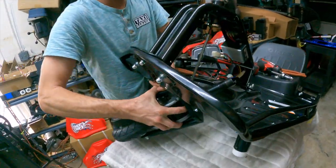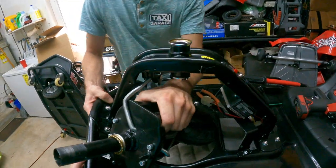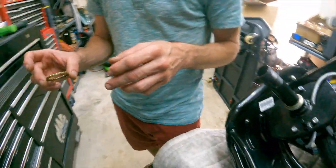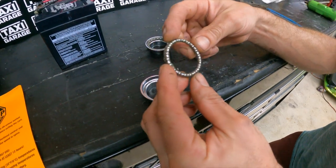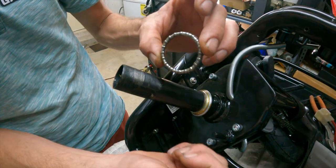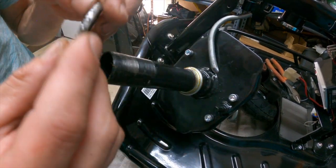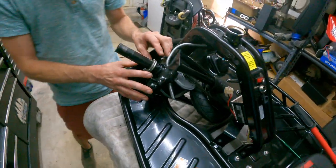Pull this piece out to the side, then set the cart back down so you can service it. This way you don't have to fully remove the wiring but you can still get to the lower bearing. Remove the old lower bearing and take your new bearing — check it, make sure the grease is fresh, then insert it. Always insert the lower bearing with the balls facing up. If you see only the flat edge when you install it, that's incorrect — the balls need to be visible. It's very easy to put it in upside down and cause issues.